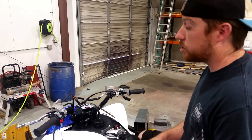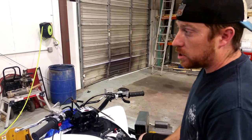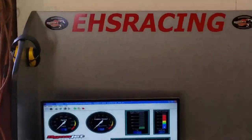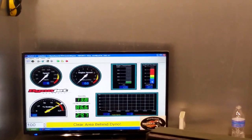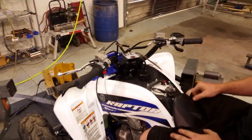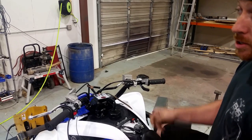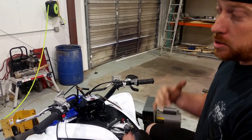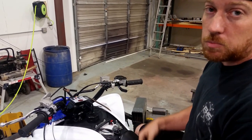We're on the dyno, so it's going to be kind of a controlled circumstance where you can hear the RPMs, watch the lights, see what the lights do. We'll show over on the air-to-fuel gauge on the dyno — on the right side of the screen, that's an air-to-fuel gauge. It says 18.4 now below it. That is your air-to-fuel ratio, how many parts air is in the gas mixture. 18.4 is basically free air. We're going to be ideally cruising around somewhere on a 13.1 to 13.5 area — that's how our O2 sensor on this dyno is going to prefer. Make horsepower, be right, not have high EGTs. You basically want to watch the gauge — it'll bounce around, you'll see 12s, you'll see 14s, but for the most part you want it to be in the sweet area of 13 to 13.5.